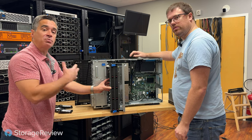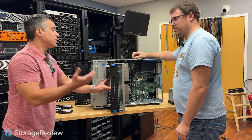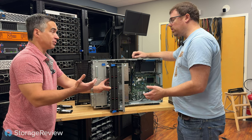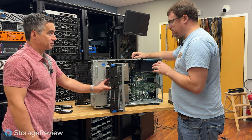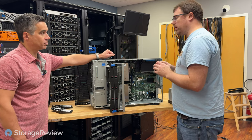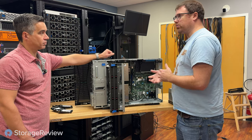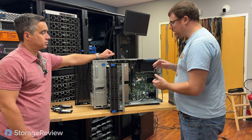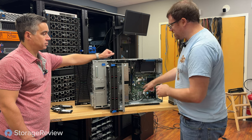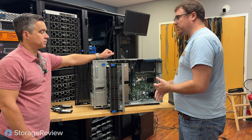If you want to unlock all the expansion capabilities of the system, you definitely want to go with the two-proc configuration. While you probably don't need the 5th Gen Xeon Scalable 64-core units, you could if you want to. A lot of servers are set up around what is offered by PCIe lanes — so even if you don't need the extra compute power, with a second CPU you get more PCIe lanes. And it's not just that a slot suddenly has double the bandwidth — some slots might not be active at all without the second CPU in place.